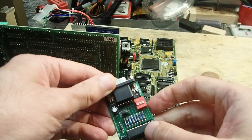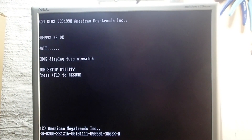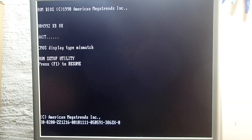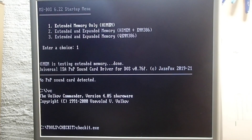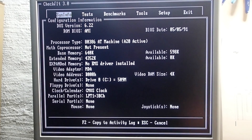The adapter is connected through the DB9 cable to the ET1000. I'll set the jumpers to monochrome and connect the VGA output to the monitor. And here we go — the card seems to be alive! We see the high-resolution Hercules text mode on the screen. The BIOS complains about a display type mismatch since I used this board with the OTI 077 card before. Once in BIOS we don't need to set anything — the display is completely monochrome. We just save the settings, reboot, and we're in DOS. Let's start CheckIt once again. It detects the video card as a monochrome display adapter — sort of right, but again the video memory size shows as 4 kilobytes, which is completely wrong since the card has 64 kilobytes.